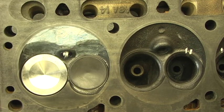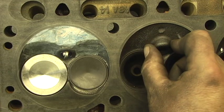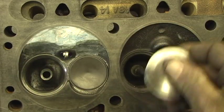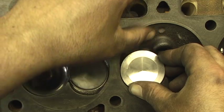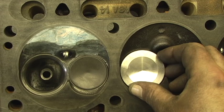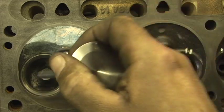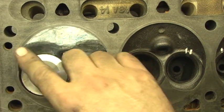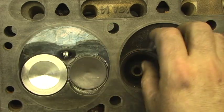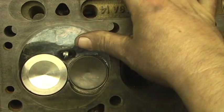It's not at all hard to see. If you look at this chamber here, look at the dead spots. You can see the plug boss and the depth of it. While it does look neat for unshrouding, you've got this big dead spot right here where it's coming out. It's not a quench area. It's called surface-to-volume ratio. This chamber is going to burn so much better that it's going to make a pretty decent horsepower gain. Even if the compression ratios somehow were the same, this one is going to make a lot more power and burn a lot better.